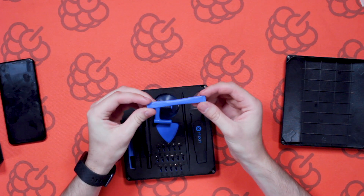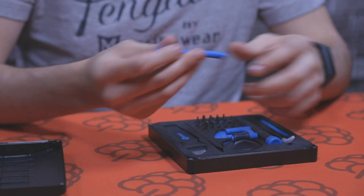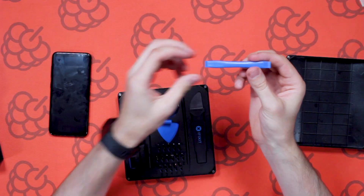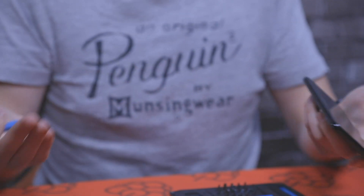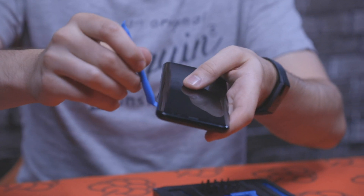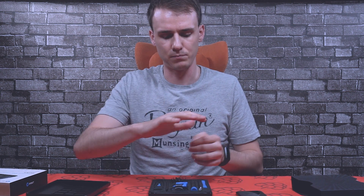The next thing we have here is one of the iFixit opening tools, and this is perfect for if you've got an iPhone or any sort of smartphone or tablet and you've broken the screen and you need to get it off. Normally you'll try and find some sort of tool to get in there and pry the screen off. This is perfect as it's plastic, very strong but also quite durable so you can bend it. For example, here we've got a Galaxy S8 — if I wanted to take the screen off and replace it, I can just clip it in there and pull down and push it straight off.